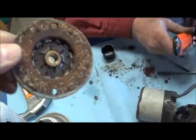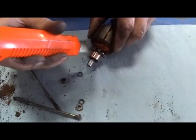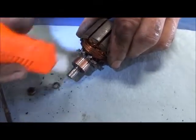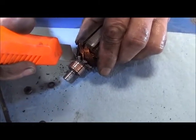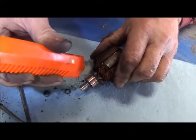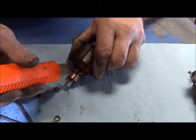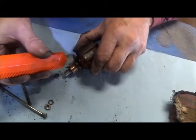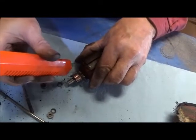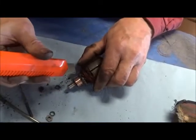What I did is I chucked the armature up into a drill motor and spun it with some emery cloth, and cleaned off the commutator and also the shafts on either end. Now what I'm doing is cleaning the gunk out between the commutator conductors — this is from probably sitting with water in it. What'll happen is if the commutator is ruined it'll bridge across the two; you'll see actual copper material. Sometimes you can save it by cleaning it out with a small tapered file tip, or doing what I'm doing. For larger motors you can use a hacksaw blade to actually cut the groove.